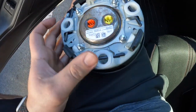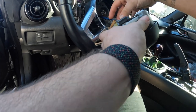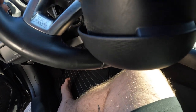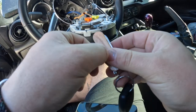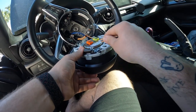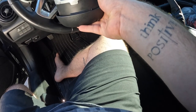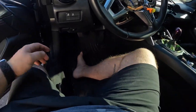Push, push, push — once you get all three out it kind of just pops out. Then you have a ground that you have to push down in the middle and then you can pull it out. You have these little black trim clips, so what I do is I use a little knife — you can use a pick tool. Wiggle it back and forth to get it out, then move your ticking time bomb off to the side.